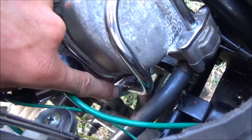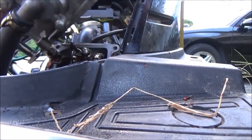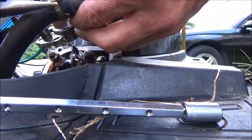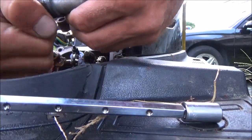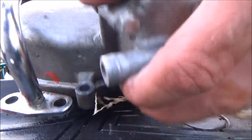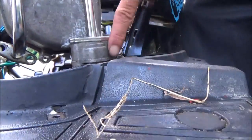We're not going to have this anymore. Once you remove the screws on the valve cover, you can take the hose for the PAIR system off — just use some pliers. This is how to remove the PAIR system: you remove these three screws and that'll remove all of this silver part here.